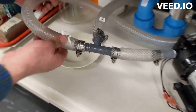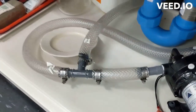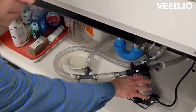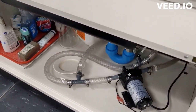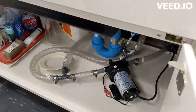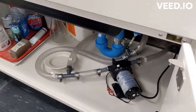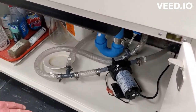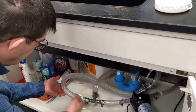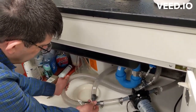That little sound was a little bit of air — it's not enough to worry about. But this is what you definitely need to avoid: see that little air bubble? If there's too much air in this line, the pump cannot maintain pressure — it can do it with liquids but not with gas. If there's too much air, this will run continuously, come out as air, you'll think everything's broken, it'll make a lot of noise and get very hot. At that point the only solution is to turn it off at the circuit breaker, then try to prime it and let it cool down. You have to hold the line up so the air bubbles flow out to the sink and don't stay in there.